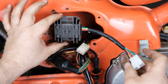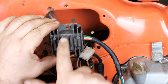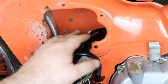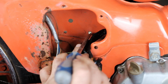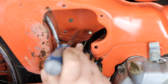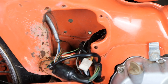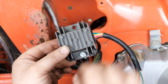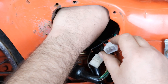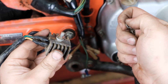Let's get ready to install the new combo rectifier unit. It's going to install facing this direction with the wires towards the front of the bike, and we're only going to utilize the bottom mounting hole. We'll show you why we're not using the top hole — we'll be using the existing holes in the frame. I'm using this hole right here, which was the other hole for the V-bracket back in the day. Our original unit was on this one, but we're going to go to this one now. The bolt that comes with it is an M6 by 14, and I'll get it through the hole and into place.